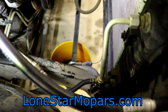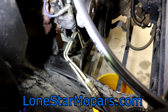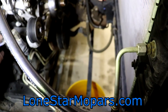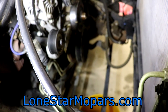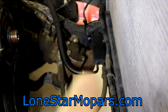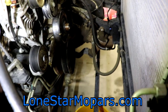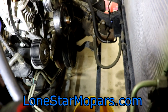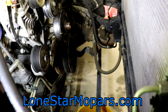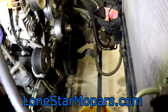All these lines here are going to be on the two sides — that'll be for our automatic transmission cooler. You can see the hard lines bundled up right there; they transition to soft lines going to the radiator. We're going to need to remove those and plug them. Down there is what looks like a miniature radiator in black — I'm guessing the truck has a power steering cooler. It would feed in, cool, and come back into the steering gear down there — that ugly brown thing bolted to the frame rail. We're going to figure out if that's going to complicate things.